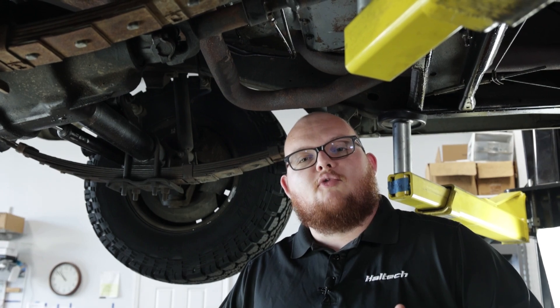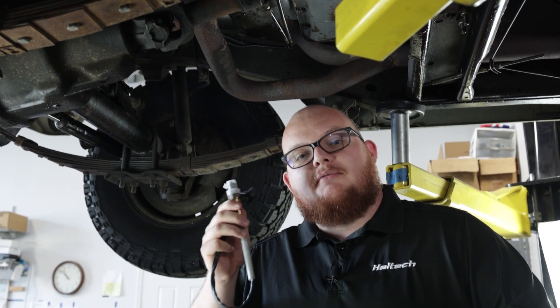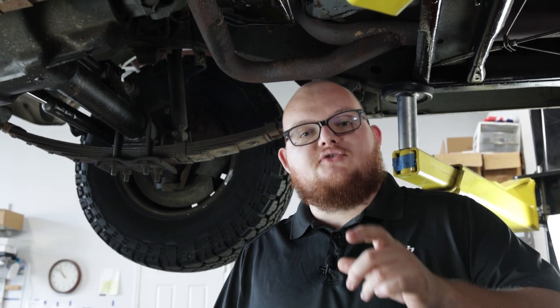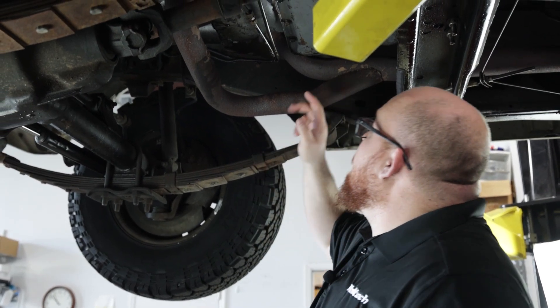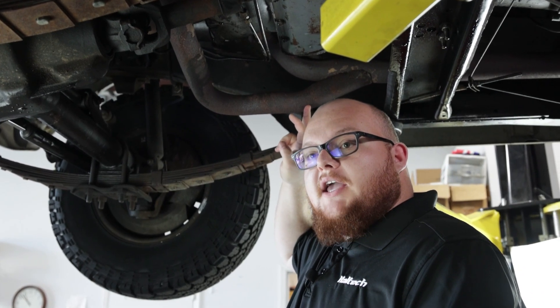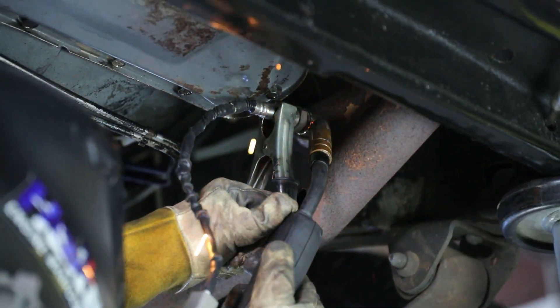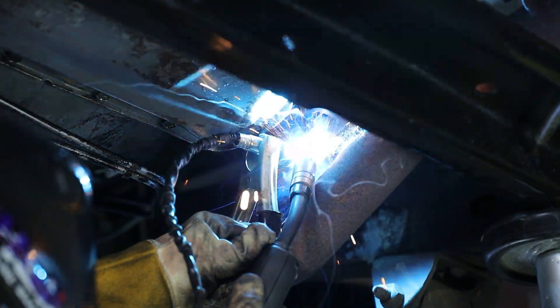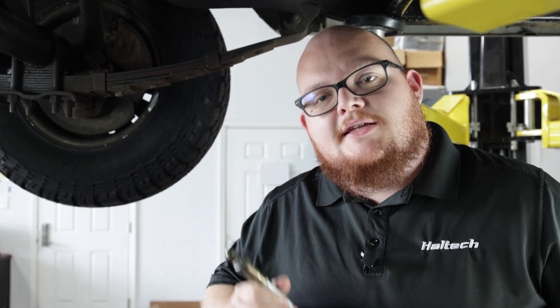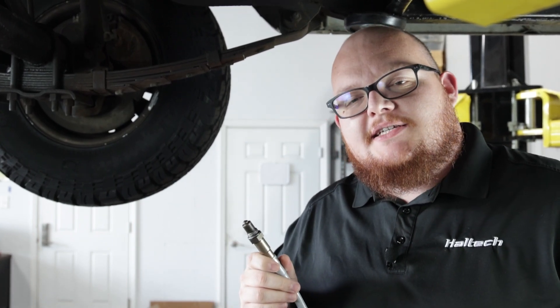The other thing that requires us to lift the vehicle is the installation of a wideband oxygen sensor. This is an optional upgrade for your standalone IC7 that allows you to plug and play with one of our wideband control modules. On this application, we're going to run two sensors — first off the passenger side of the bank, and here off the driver's side of the bank. Now we have our exhaust bungs welded in, sprayed a little chassis black, and cleaned some stuff up. It's time to install our O2 sensor, which already has a bead of anti-seize on it.